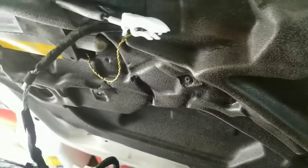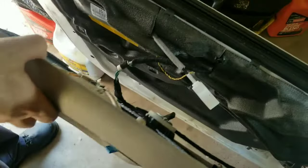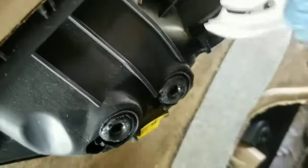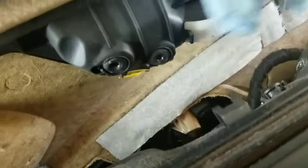After you get the speakers and the wiring harness connected, make sure that you run your switch wire through the hole right there. As you're putting your door panel back up, right where you've got your door release, just slide that right back in there and push it back in. You'll see the little clips on the door — they'll line up with the clips on the door panel side and simply just push on. Once you get those on, you want the window open so you can get everything aligned, get the top back on along with your lock knob back into the hole, and slowly push the panel back on.